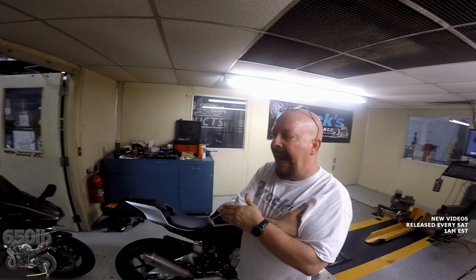Wow. Now, one of the problems that we have with our new dyno is, as I was telling you, our numbers are out the window. People want to hear, hey, does it make 280? Not on this dyno, and it's not going to. Those days are gone. I can tell you that before we went to Mojave, we put the bike that Kent was riding on the Sport Rider dyno. They also had WinPep 8, and just to proof our same kit, our Stage 2 kit, and that bike, we're on the SAE scale. There was absolutely nothing that I could do, no tuning, no nothing. It would not break 250 horsepower on the SAE scale. It won't do it.